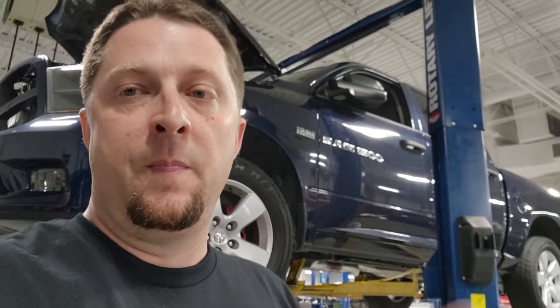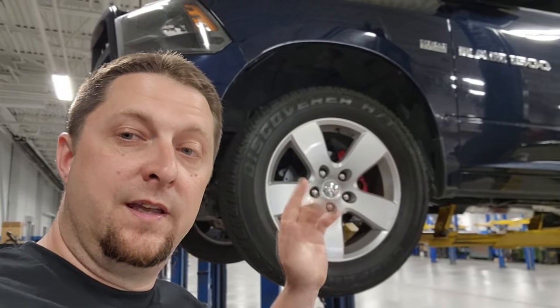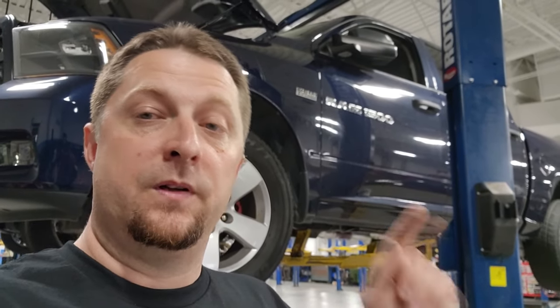We just need a little more fuel because the wideband gauge is just barely on the lean side. So this should get us fixed up to where we can enjoy the truck again and hit the track and beat on her. So let's get the tank dropped and get this stock fuel hat out and try to make this Holley 340 pump fit inside the Ram stock basket.